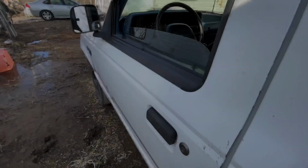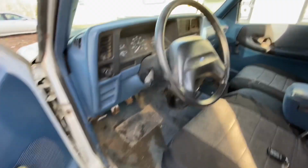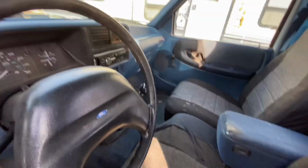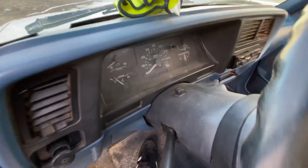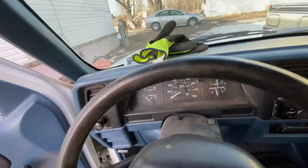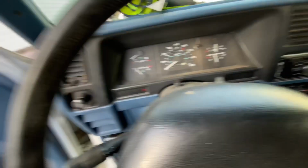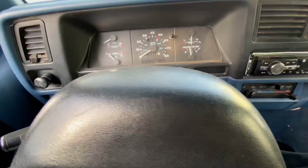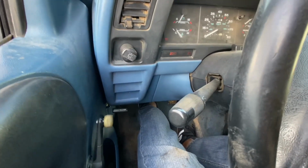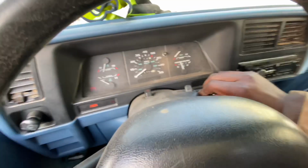And when you go to tighten it, please don't use excessive force. It's just a normal bleed screw. Everything else, of course, is internal, so you don't really see the clutch slave cylinder. So after everything is bled out, jump in the vehicle and try to drive.